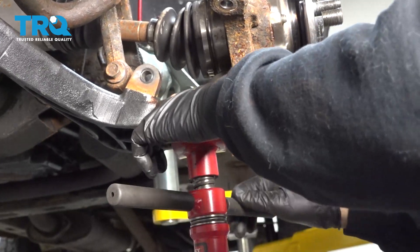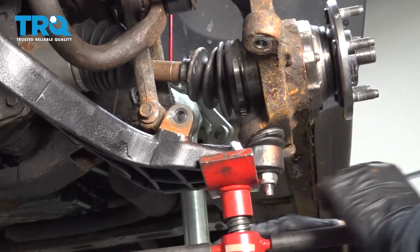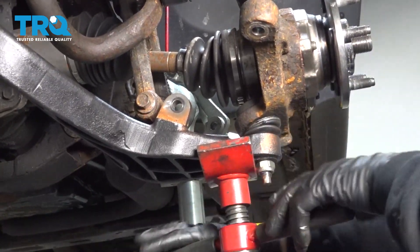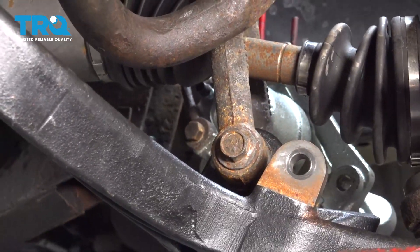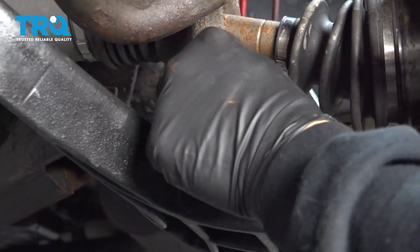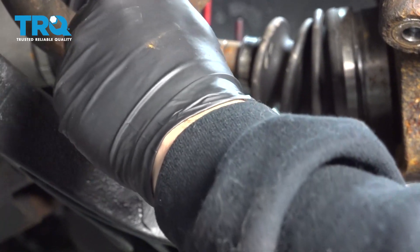What we're doing is releasing all of the strut pressure on the control arm just so it's not dropped all the way. You know you're in a good position by raising the control arm if you can just pull that clevis pin or the clevis fork bolt right out.